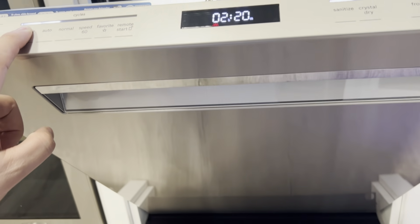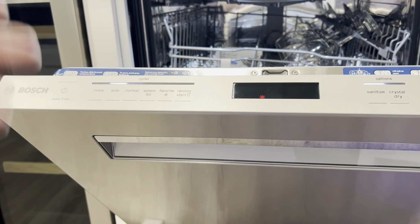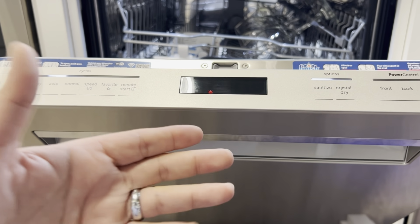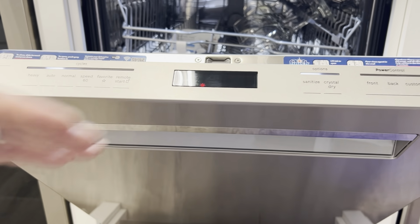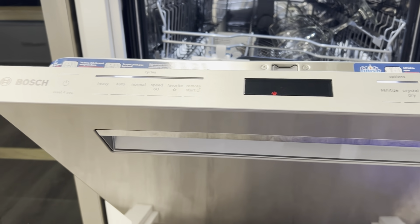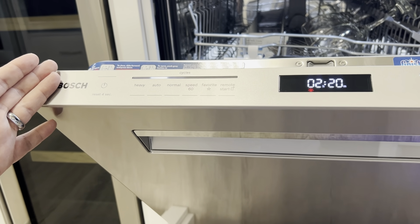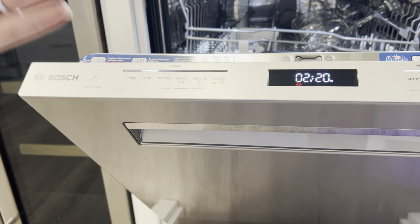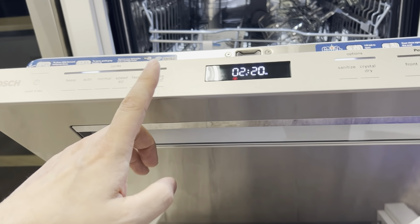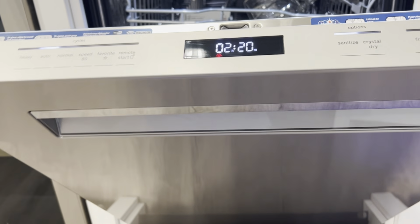These cycle times are going to be somewhat long, because one, they don't know the turbidity of the water coming through the system, so they may adjust based on the temperature of the incoming water. If you're hooking this up to hot water, like most people, and the water during that fill is cold, it's going to take longer to get up to the appropriate temperature so the system can get precise temperatures. Most American dishwashers don't actually do that. They just run assuming the water started at 120 degrees from your hot water heater. European dishwashers tend to go to a specific temperature before the soap door opens so that they can guarantee better cleaning results. That is a feature you'll have here, but it will adjust the time remaining. So starting it with hot water will probably get it to run a little bit faster in its cycle.